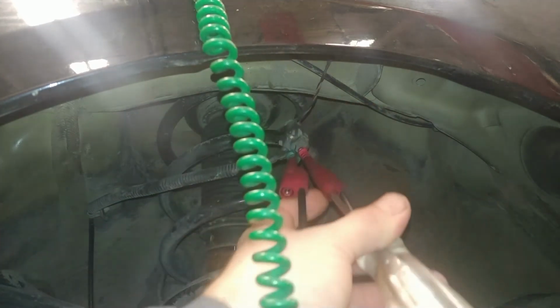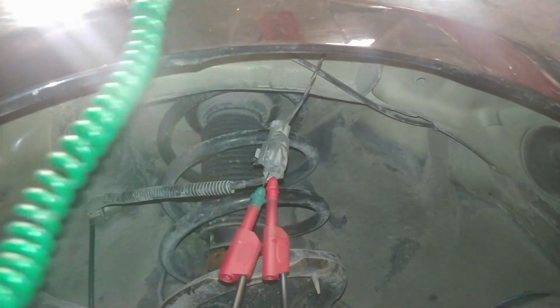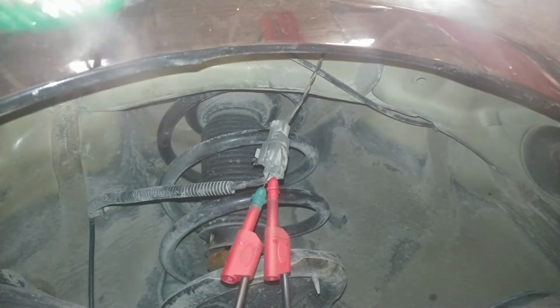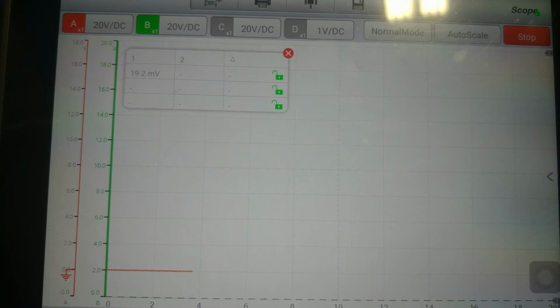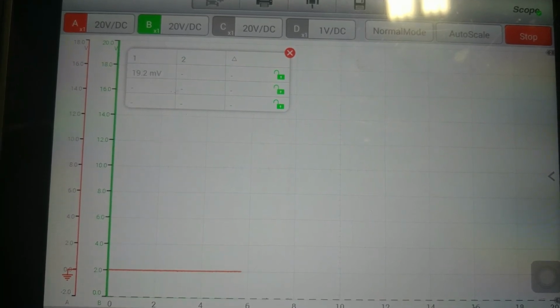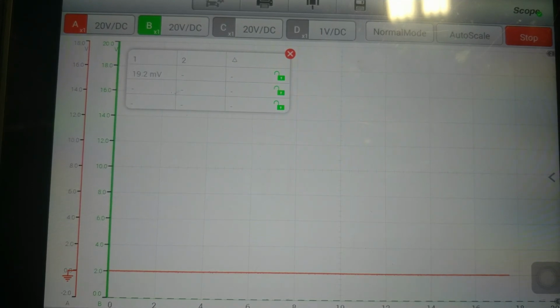And as you can see, that pulse is sent out from your ABS module, and you can check it with an LED test light hooked up to ground. Alright, so now that we know we have our 12-volt signal pulse coming out from the ABS module, that tells me that my ABS module more than likely has good integrity. Now, there's no way to tell if the signal is good on the signal side, because as soon as there's a code set, it cuts power to your ABS sensor.